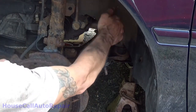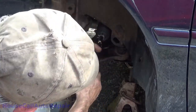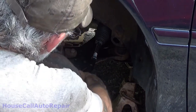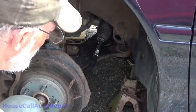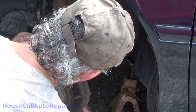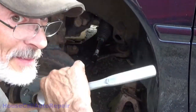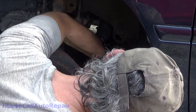spin the nut out, and then we can go ahead and set this down inside the wheel. And repeat on the other side. Tie rod end nut. That screwed on. Got the cotter pin for it. Gently tap it down. Again, everything is a hammer. And we're tightening. Yep.